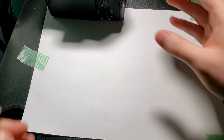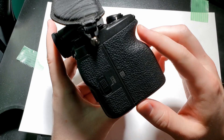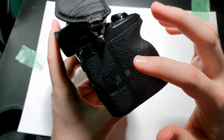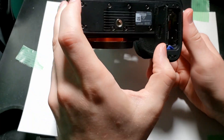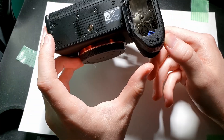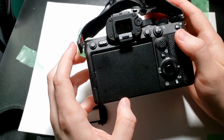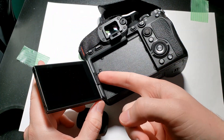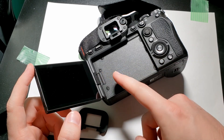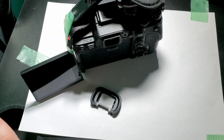The first thing I'm going to do is use some tape and identify where the screws are. There are a couple of screws — I believe three screws right here, screws on the bottom, some screws in the battery compartment which are hard to see, as well as screws in the eyepiece holder. Eventually you will be taking out this whole front piece to get access to the loose screw behind it. Let's unscrew the eyepiece portion.